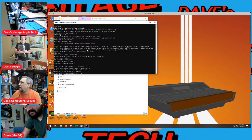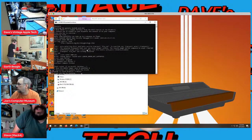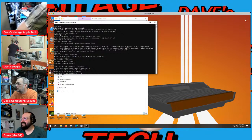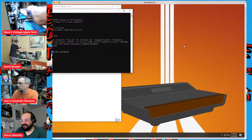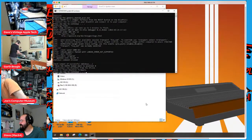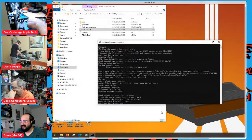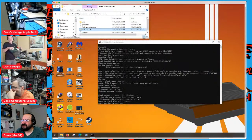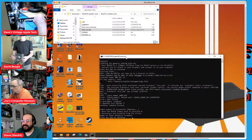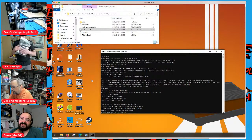LibUSB error not supported. So now that gives us an error message that we can do something with. Stand by. You said Windows would be easier, Joe. It is. You lie. Yeah, Joe, it's supposed to be. That was easy. Wow. There, deal with that. I'm glad the people in the chat are finding this entertaining. Our suffering is your entertainment. You may need to tell Windows to use the correct driver by using Zadig and switching the Maple device to libusb-win32.